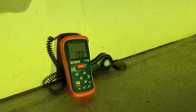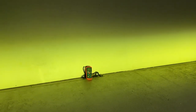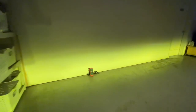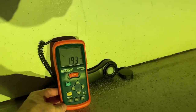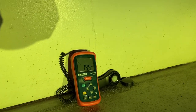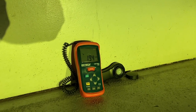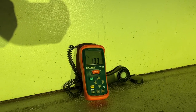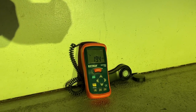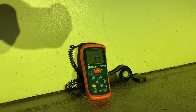The new fog lights are hitting about 80 lux previously, and now we've got almost 200 — so solid twice as bright in terms of sheer intensity, and you've also got better beam distribution. This has a really nice yellow color if that's what you're looking for. If you step up to the Pro or even the Max, the Max would be about twice as bright as this Sport, so expect roughly four times brighter than stock — although it does come at a premium price.